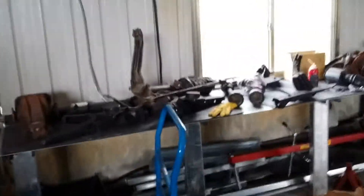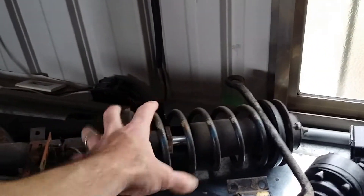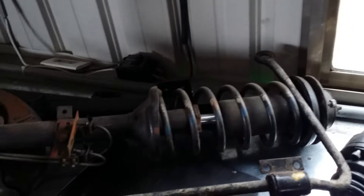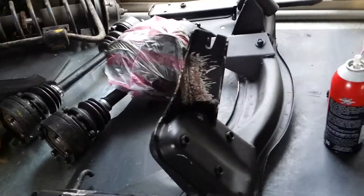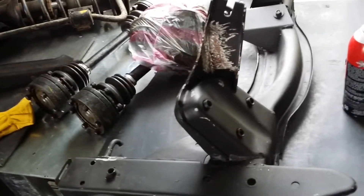There are some little tidbits. The pedal box I'm going to be working on soon with Mark. I've got a load of components over here that need to be cleaned up before reassembly. These suspension dampers have to be changed, so I'm keeping them as one component at the moment until we get the new dampers. I don't want to disassemble too many things and have bits lying around in case they get lost. Disassembling and reassembling isn't a big job but I need those dampers first. This is the front subframe which I did some work on — it just has to be re-welded, strip the crappy paint off and repaint before it goes back in. That's like a two or three day job.